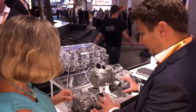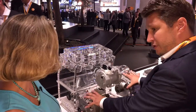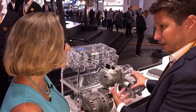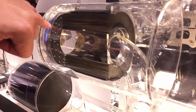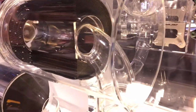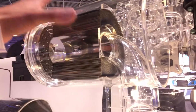Being able to recuperate it — that's the deal. You can do a lot. This is really the nice story behind it: it's an efficiency measure, because with this electric energy you can support the ICE to increase the overall efficiency of the drivetrain. We are really using this electrical energy to make a load-independent temperature control of the exhaust after-treatment.